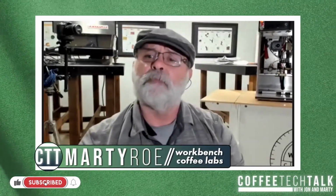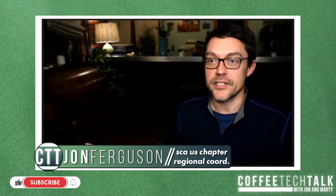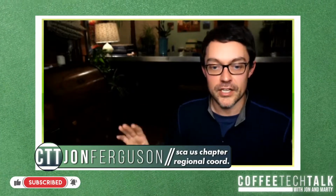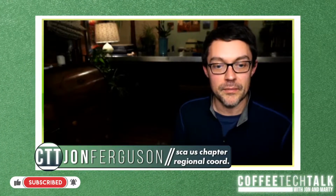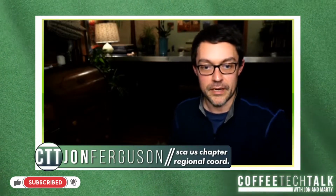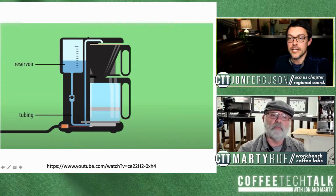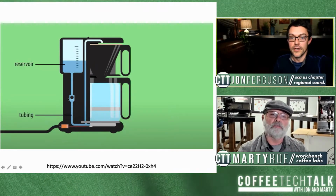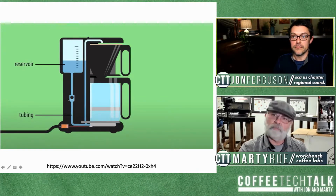Well, yeah, because I've taken one of these apart. I went to the thrift store and bought one for like $5 just because I was curious. I took all the plastic off of it and looked at the insides, wondering what a coffee brewer is actually doing. There was power, some sort of heating element, a water reservoir, and some tubing that goes through. It seemed like the water passed through the heating element and got hot, and then like you mentioned, there was a one-way valve that kept the boiling water from going back into the reservoir, and it forced it up the tube, and it was basically dripping over the coffee.